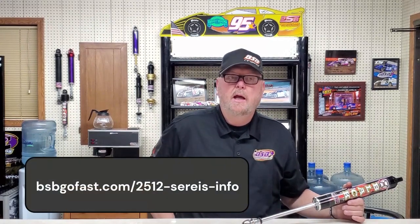This is a 15 series shock and it's going to be a bypass shock. When we do a position sensitive bleed system, currently we're only going to do it in a 25 series on the right front, left front, and right rear. The most benefit in that particular shock is in the right front — we can build a shock that gives you a lot of rebound and a lot of drive. Most people can only give you one or the other. In a normal shock, we try to blend the amount of rebound with the amount of drive, and we do favor towards the drive side.